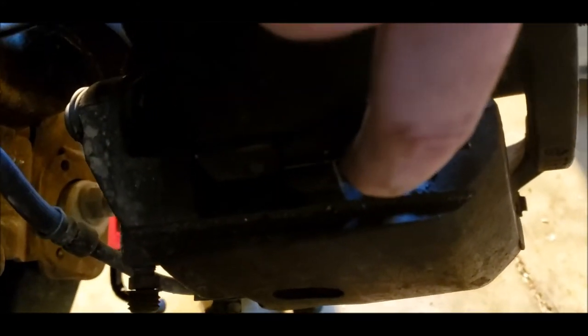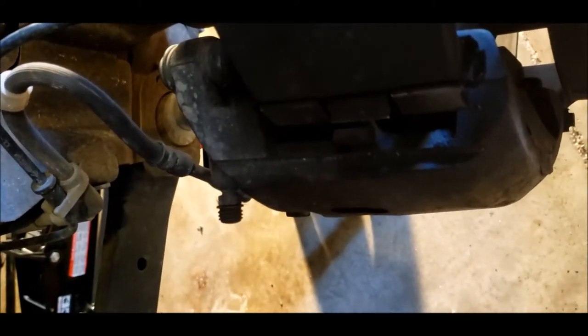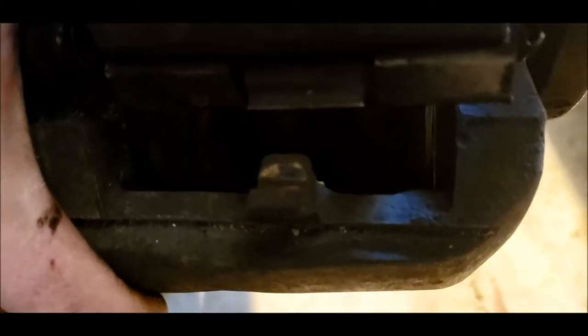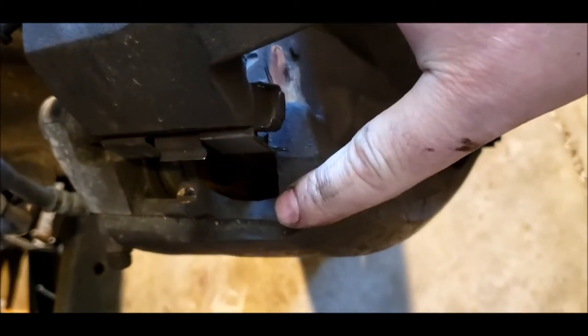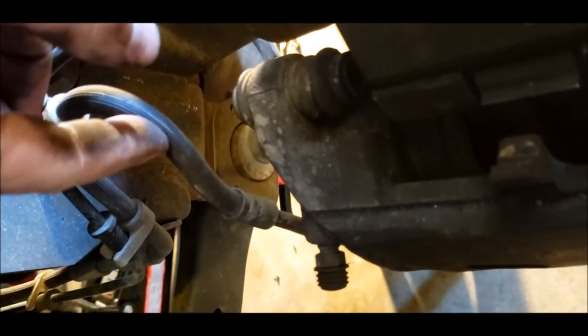Then it should come out. There's a little tab here that you have to lift up just a hair to get it over the other side. With a little pressure you can see it's starting to come off. The brake pads will stay here, and we'll just pull the caliper off. Be careful when you do it because you don't want to put any weight on the brake line. Use two hands, one up here, one down below to be really gentle, and then you can set the caliper right up here.